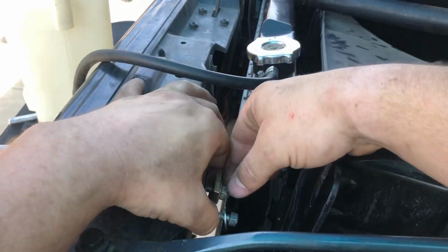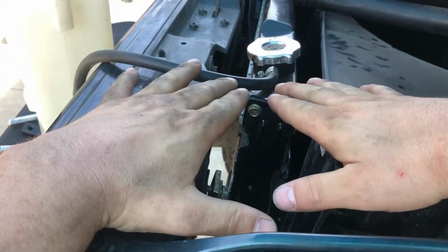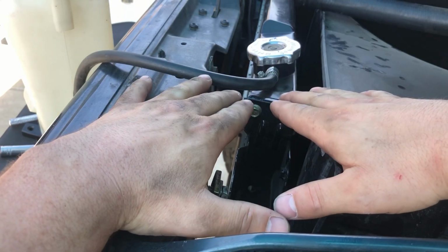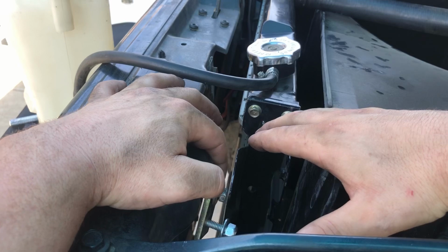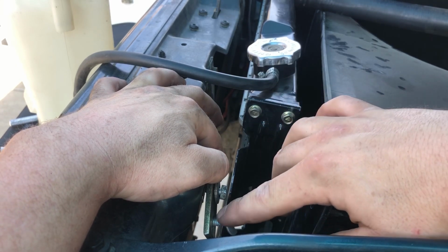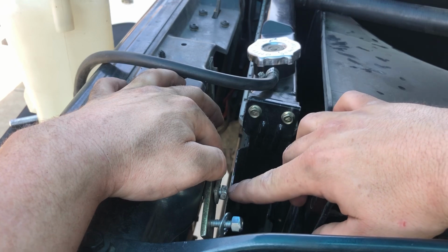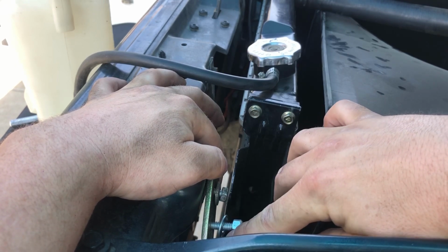Okay, so the easiest way to explain this is now that the tub is gonna be raised up 1 inch, we need to maintain the radiator's position with the fan shroud. So in order to do that, we use these 6 drop down brackets. You'll see right here, there's a stud. The radiator will now be bolting to the stud, and we'll use the factory bolts that go into the radiator support, and that's how we'll get the 1-inch drop.